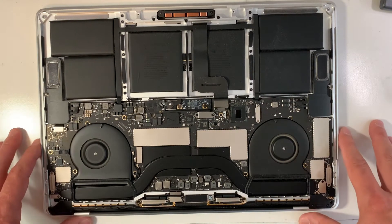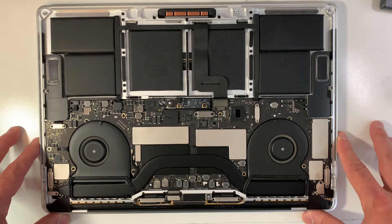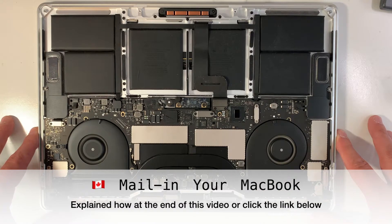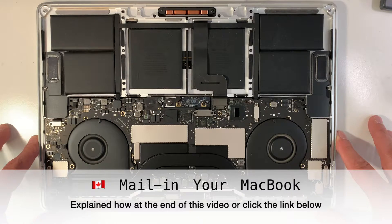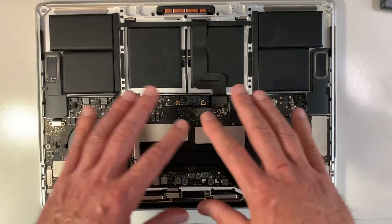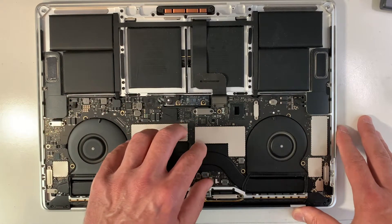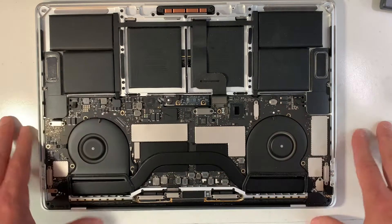Just a heads up: if you have a MacBook Air or Pro from 2017 or earlier and you have a problem similar to this, it can be fixed. If it's 2018 or newer — 2018, 2019 — it's a T2 chip, so you won't be able to do that. Or if it's 2021 with the M1 and newer, you will not be able to remove the lock — very unlikely. So I'm going to take off the board, remove the BIOS chip, show you how to do it, and tell you what I use.